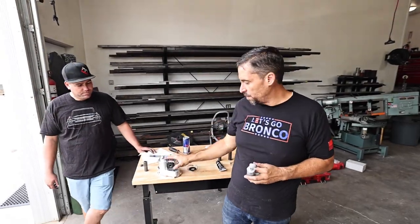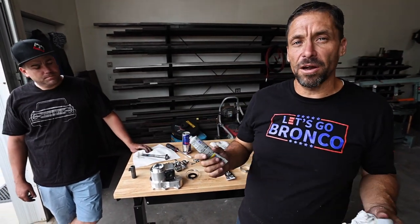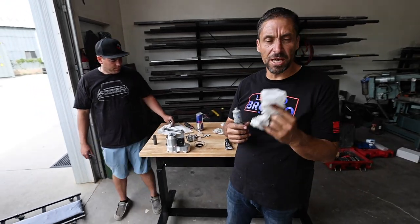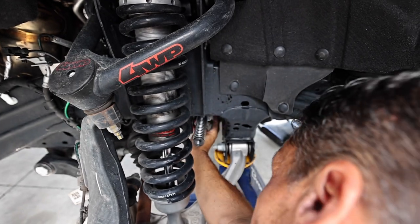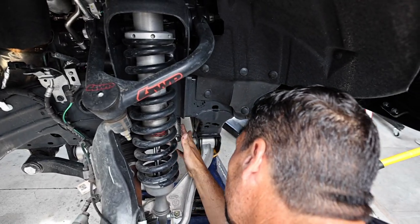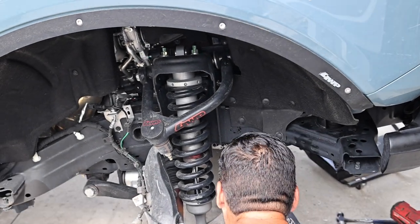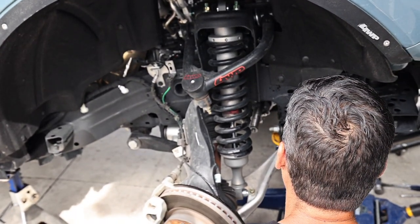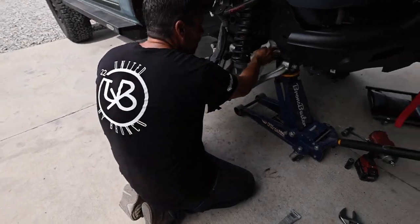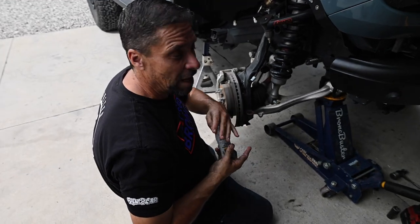Install the dowel pins in the same corresponding holes — you'll see there's a little step down in there, so that's the correct location. Once the dowel pins are in and the bolts have been installed, this is ready to reinstall. Last thing is to clean any debris that may have fallen onto that rack and ball screw by adding some grease, cycling the steering in and out, and then wiping it clean another time or two until you start seeing less debris coming out. Go ahead and do one more cycle in and out.